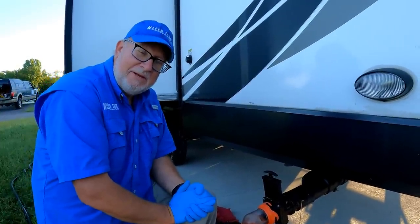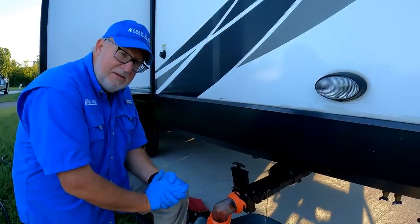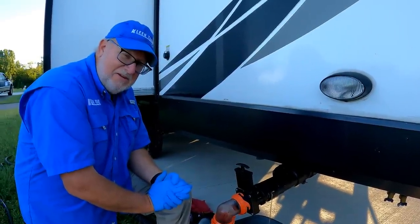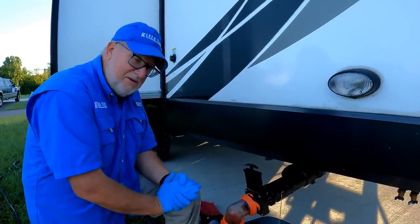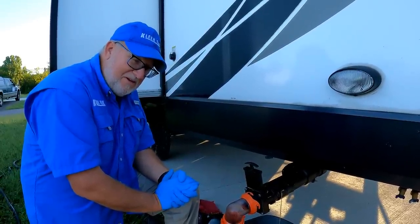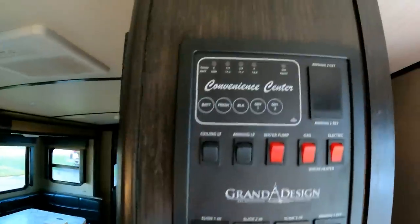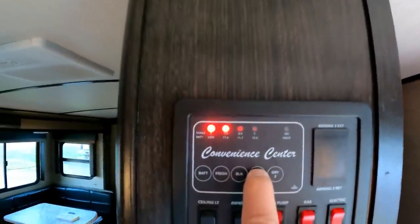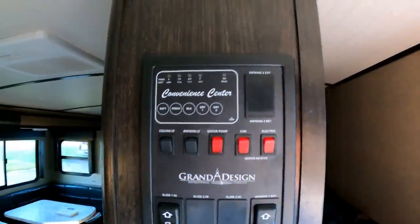So from an owner's standpoint, I flushed this thoroughly the last time I was here and I've only been here for a full day — this is TMI but no number twos this trip. So I feel like this tank is pretty darn clean. When I flush it I close it, let the black tank flush fill again, let the gravity of the water pull stuff out, and it runs clear. But I'm afraid we're gonna find out differently. Let's check the black tank sensor. The black says it's a third full — we know it's empty. Gray one: same thing, a third full. Gray two says it's empty. So yeah, obviously the first sensor is coated with something.